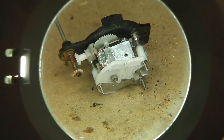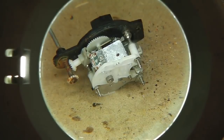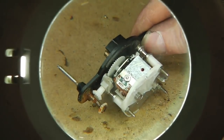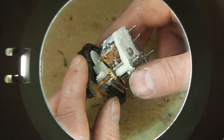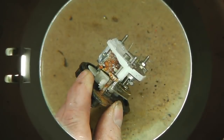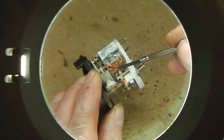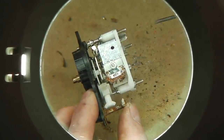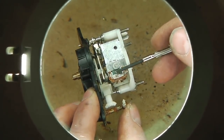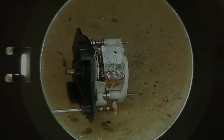Okay, I'm into the clock. There's a little bit seized, one of the little grub screws that holds that metal tang seized solid in, so I had to drill it, but we're in. And now we can have a look at that relay, the armature that fires the counterweight. It looks corroded there. That should be pushing in and it's not, so it'll be seized on the fulcrum point, I would have thought, around that area. So we're going to have to unseize that. It could be some penetrating oil on it now and see.